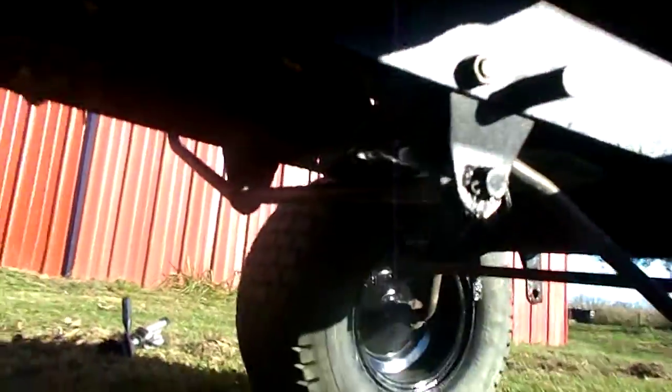I don't know if you can see those pulleys, but one's here. I don't think this camera's in focus, but one's there, and the other one's over there. There's just two idler pulleys to make sure my belt doesn't rub against anything underneath here. These two pulleys, here and there, are completely worn out. They make so much noise down here, it's ringing my ears. That's where the noise is coming from, these two idler pulleys I have here, just to keep my belt tension to the front pulley.